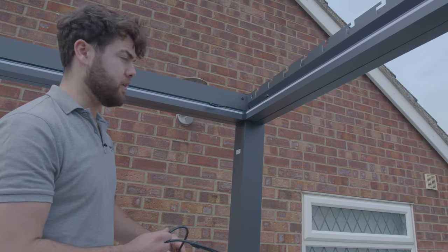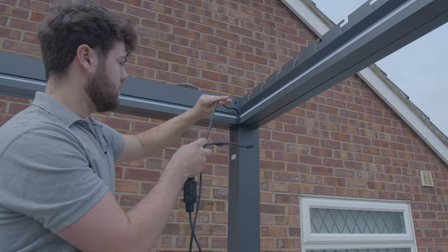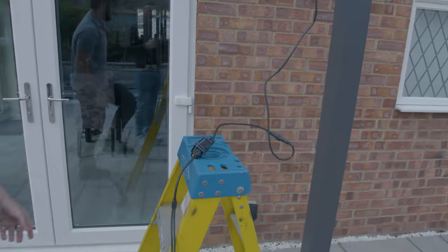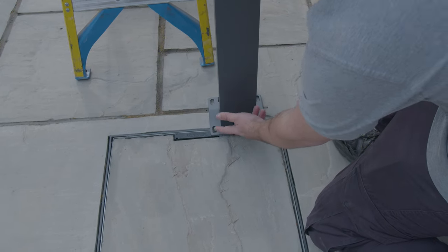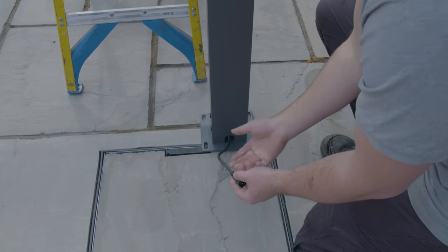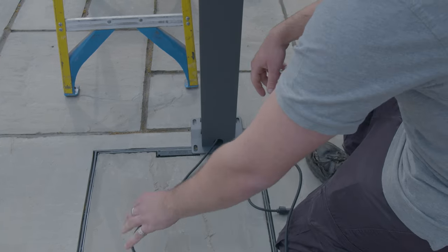Through the centre of that rubber insert that we put in earlier there's a hole, and we're just going to feed the cable all the way down until I feel the wire hit the bottom. At that point it's reached the bottom so I'll just rest this down here for now, whilst we fish the end of the cable out from the bottom. This bit can be quite tricky — often takes a lot of moving the wire around. This is the drain hole; sometimes it will come out nice and easily, sometimes it won't. It's basically a case of just fishing the bottom of the cable out through that drain hole. At that point you just want to feed it through as far as it will come without pulling on it too tightly.